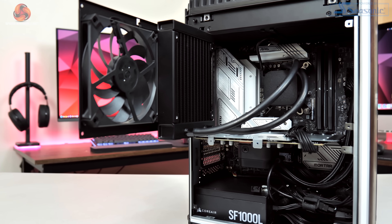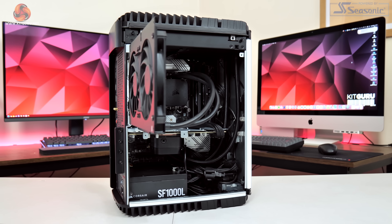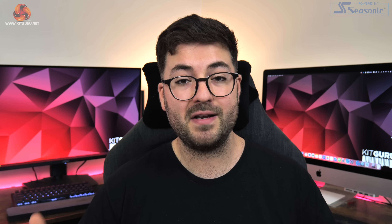I also wanted to rerun a bunch of different gaming tests, which is something I always do for a pre-built system review. I just didn't do a very good job of explaining where I was getting my figures from when talking about thermal performance. What you're going to see here is a 30-minute stress test of Cyberpunk 2077 at 4K using ultra settings, with HW Info up giving a live readout of both the CPU and GPU metrics. Ambient temperature this week has been a little bit higher — 23 degrees compared to 20 degrees during my original testing — and I've also put the Corsair dashboard on screen so you can see a live readout of the fan speeds.